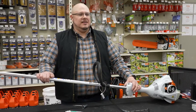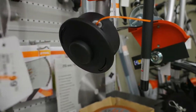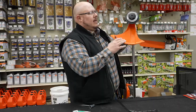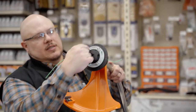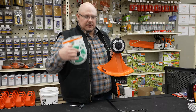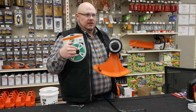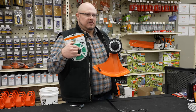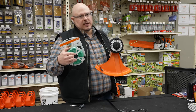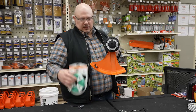Another item I'd like to show on this trimmer is the trimmer head — it's probably one of the more frustrating things you can do with a trimmer, having to rewind the head. On this particular unit it is much simpler. STIHL has come out with a new style head, and anytime you see this gray ring here it's typically that newer style head. With STIHL, you typically just match the color of line — a lot of their curved shafts run a green line, a lot of their straight shafts run an orange line. That's a pretty good rule of thumb for matching up to the original line.